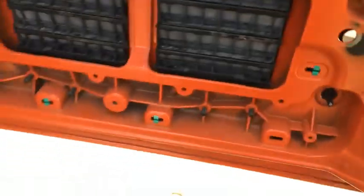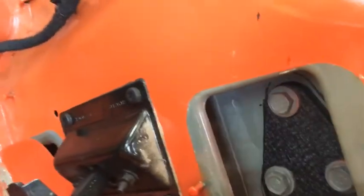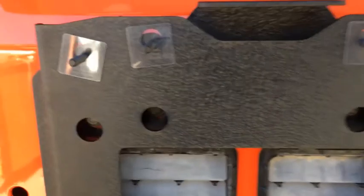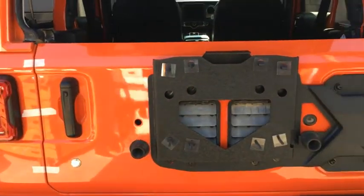Now we're going to go ahead and close the door. Alright, so I went ahead and closed the door. We tightened up these six bolts here and the body lines came out okay, but the tape is a little bit off — subjective, right? And then we put these eight bolts and these four button head bolts. Now for the moment of truth — seems to open okay, and it closes. So we're good.